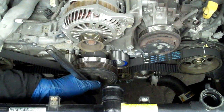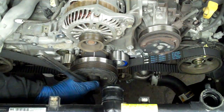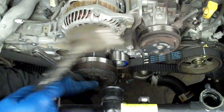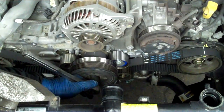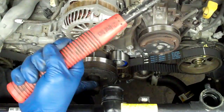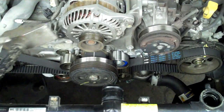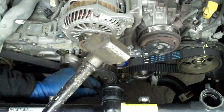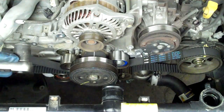As you go close to where this mark is pointing up at 45 degrees, the engine will be under a lot of compression - that's when you're more likely to be at top dead center. When you're at top dead center, you just smack it. Most cars you do top dead center to put the timing belt on, but not these - this mid-stroke method is better because you don't get into trouble. You want to be choked up on your hammer, hitting on the end of the ratchet to maximize it. The worst case scenario is hitting your power steering pump, alternator, or breaking the ratchet. Take measures to ensure that doesn't happen, and eventually you'll get it to crack loose and it'll come out no problem.